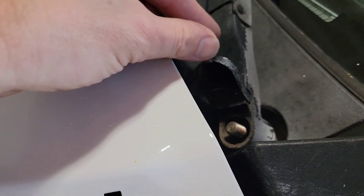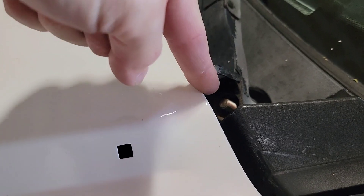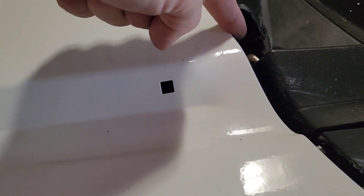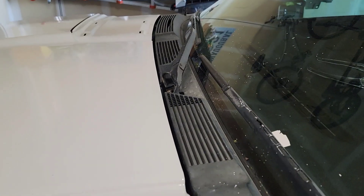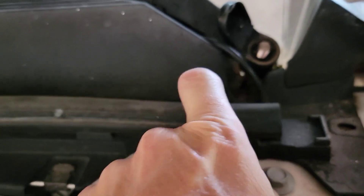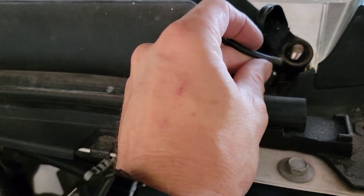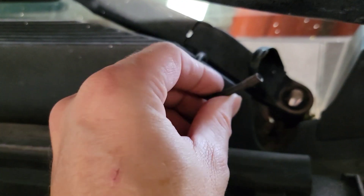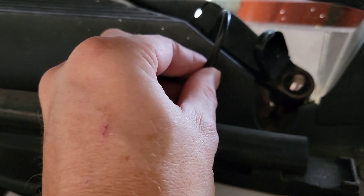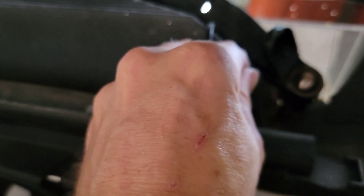You need to get a little flat blade and try and pick up this prong. You can buy these separate — so if yours are broken and gone, you can reorder some of those. That nut right there is a 15mm. We're going to pop this open before the hood's open, but don't try and take that nut off with the hood down — you'll end up beating this up and scratching it. Once you get this raised, you're going to need a 15mm, and I would suggest a short socket. There is this windshield washer fluid line — it connects down there. Be real careful with any vacuum line or hose — try and get it off with your fingers because if you use pliers they're probably going to tear it.